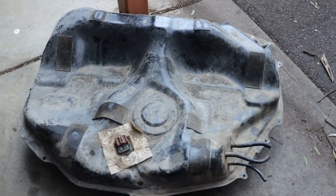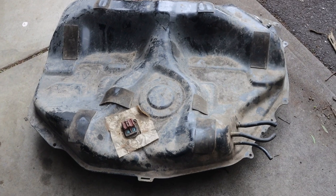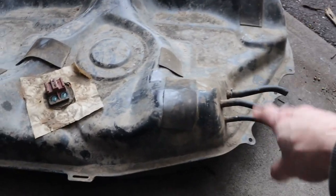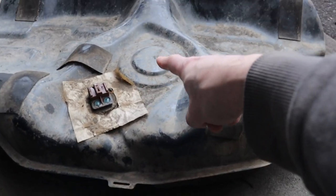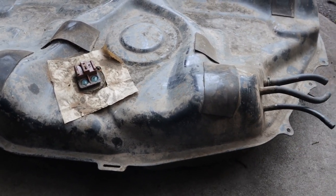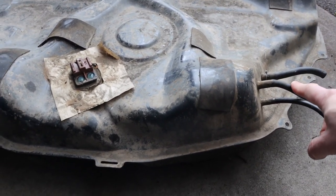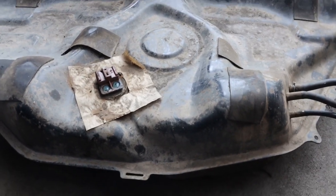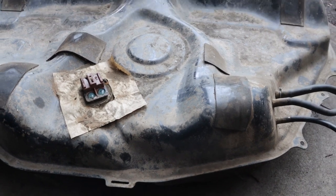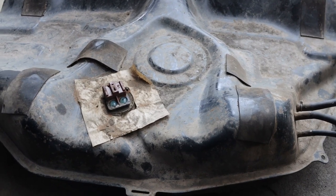The straps and everything that mount the tank all fit perfectly — it straps up there fine, no issues. The lines that go to the pump need to be a bit longer, about 30 centimeters instead of maybe 15 centimeters. Also, these lines are not high pressure, so replace your lines to the hard line all the way up. You can get those at any auto parts store — just get about a one or one-and-a-half meter length of each size and you'll be fine.